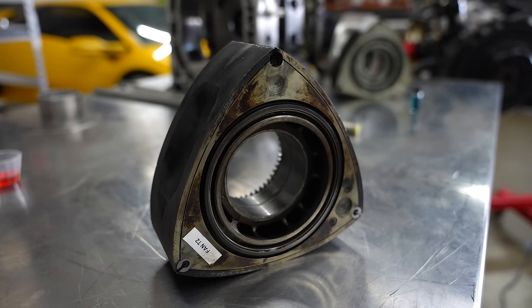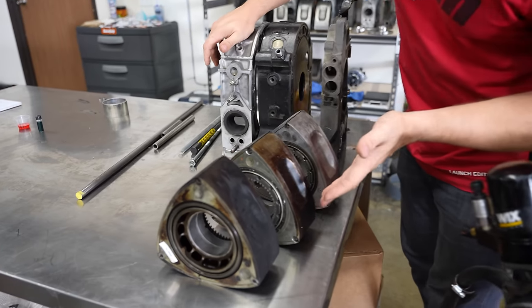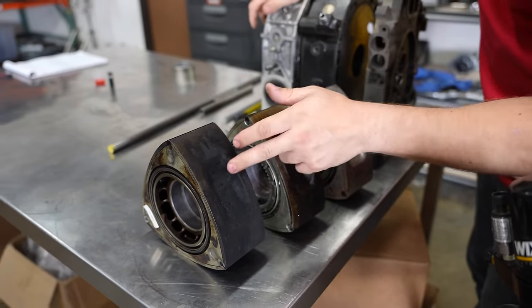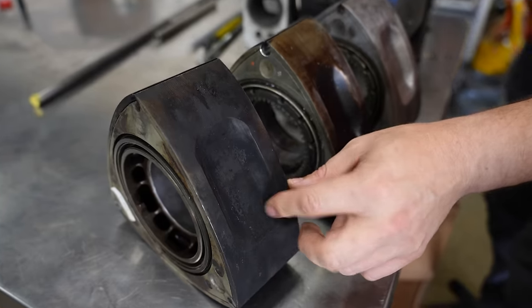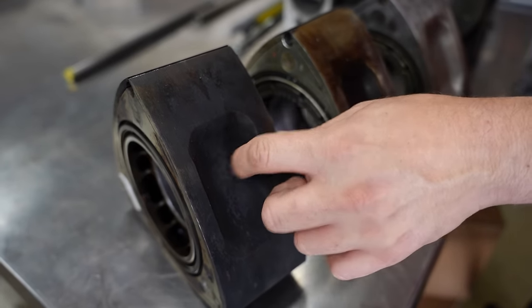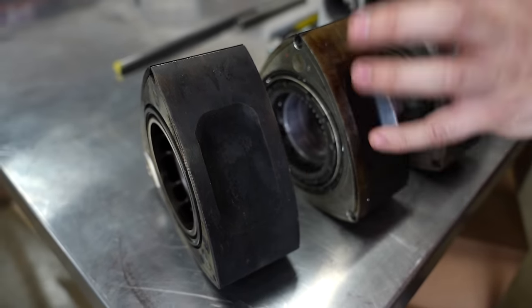This is our lovely little rotor, and these are all rotors with different types of problems that have occurred. I will be harping on this the most. This is carbon deposits — that crap right there. Just like when I was at Valvoline's engine lab last month, all these deposits are a major no on rotary engines.